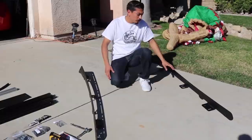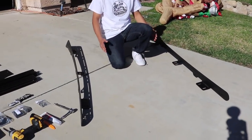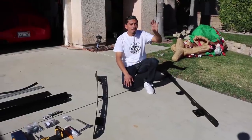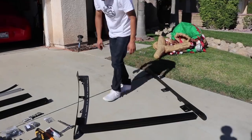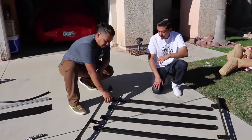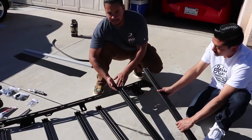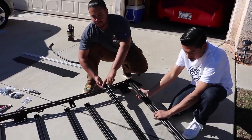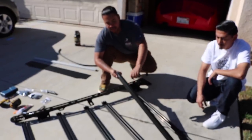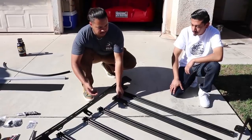Right now we're just assembling the roof rack on a flat surface. Get your left and right side of the rack and make sure the tabs are pointed in the correct direction — this is where the bolts will bolt down to the truck. When you lay out your crossbars with the side rail, make sure the openings are facing up so you can mount things later. If you order load panels from Prinsu, they slide into the channel, and this also lets you install T-nuts or rifle cases afterward.